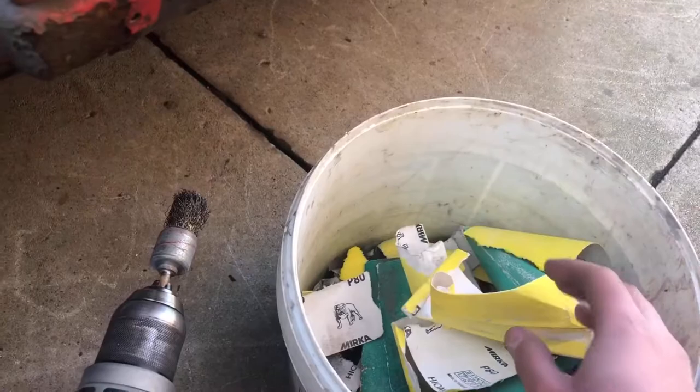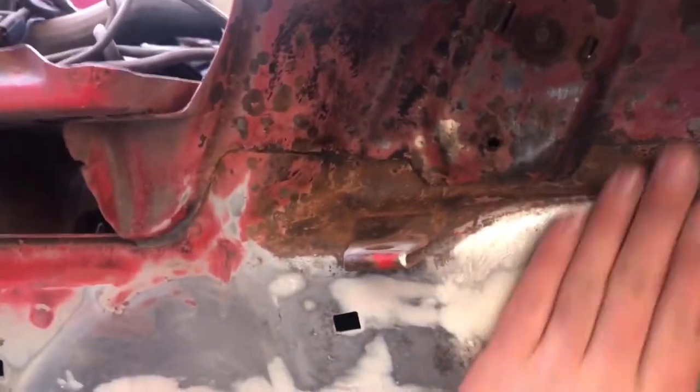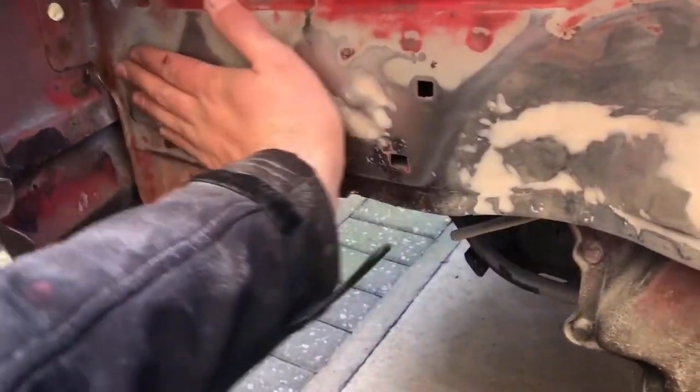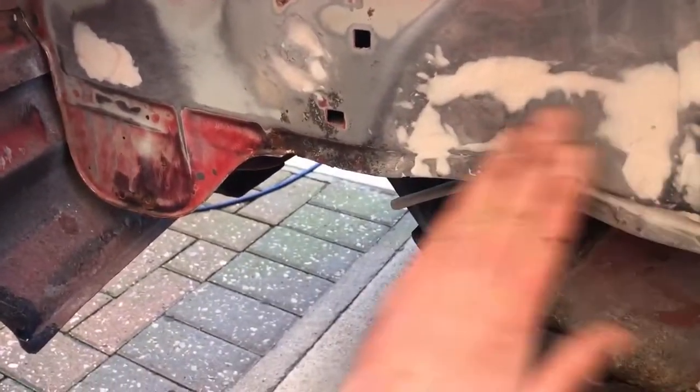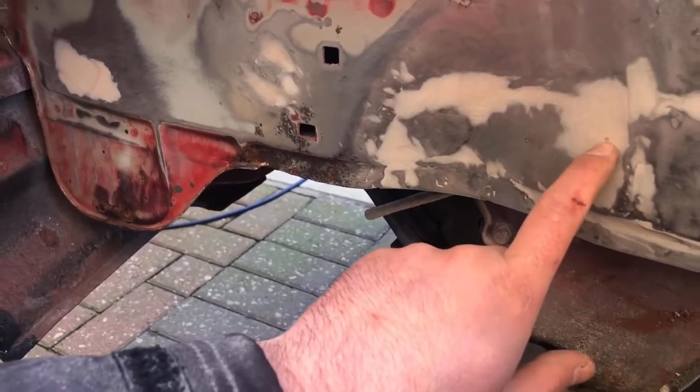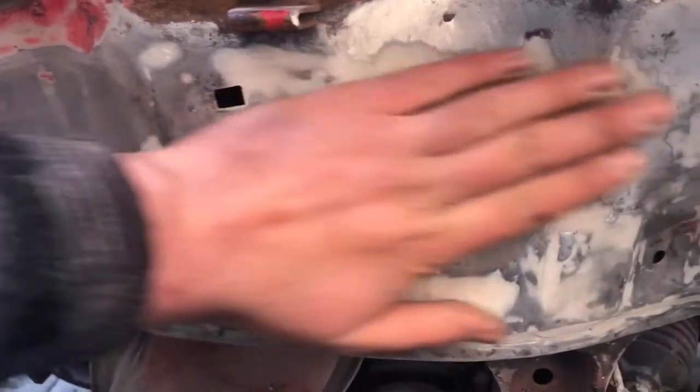It's gone from the original 5mm and then I've swooped it into nothing and then brought it back out, and it's 5mm at this point. All down here is gradually coming up to 5mm. So I'm going to sort some of the holes out, flap it off, and come back to you when I'm filling and priming. I didn't film any of this filling process because the filler — it's supposed to be easy sand but I think I've had it that long all the resins have separated so it's gone hard in the tin. I've gone through I don't know how many pieces of paper — this is all 80 grit — and it did not take any time. So there is a very minimal amount of filler on here. That is all done, that's ready for primer.